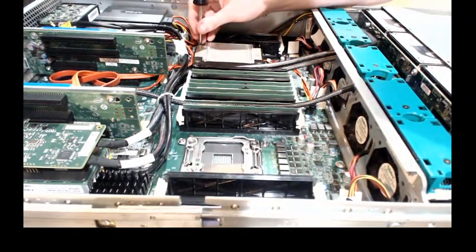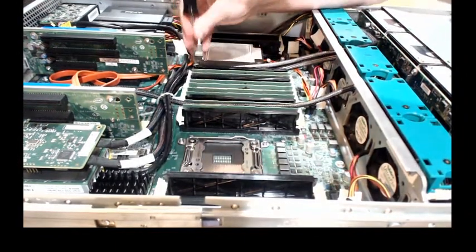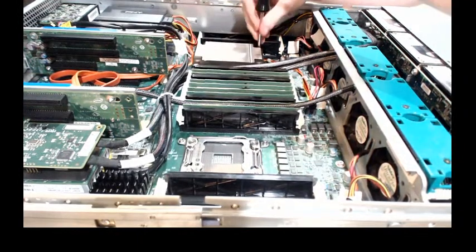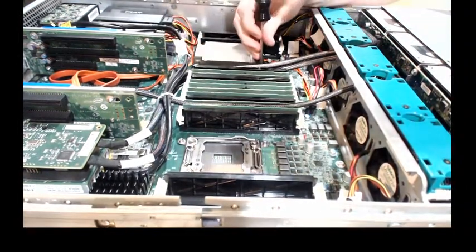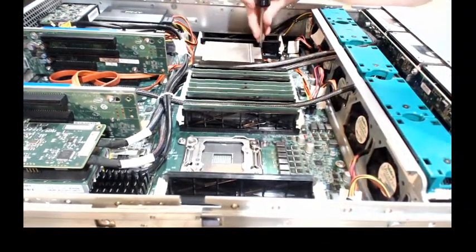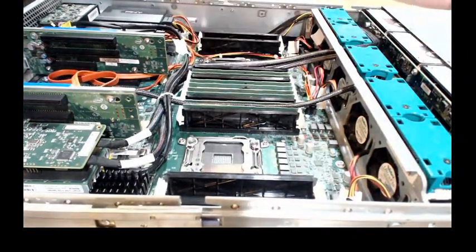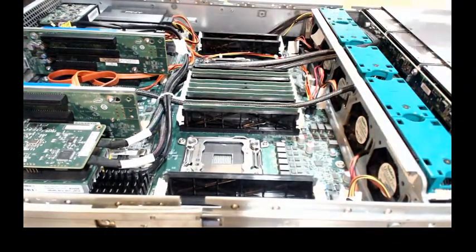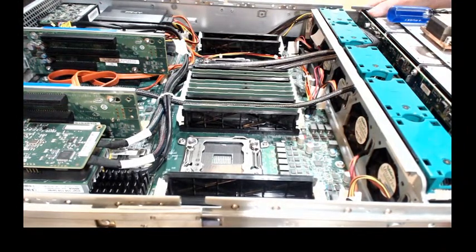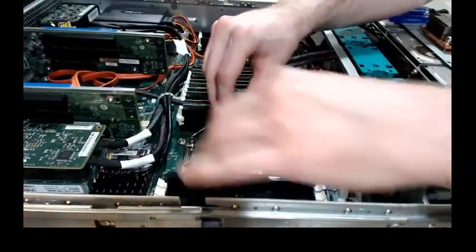And there's a whole bunch of upgrades that I haven't released a video on. Either I'm super far behind video-wise, but you can see there's a couple SSDs here, an SSD and a RAID card. I think we talked about the RAID card actually. That was in the first video. And then the last thing I upgraded in that video was the processors, and we ran into this kind of issue. So that same pin on the other socket is shining bright like a bent pin does, so I'm just going to say that's not a bent pin. And let's open up this socket.